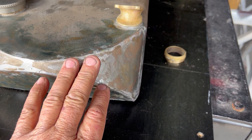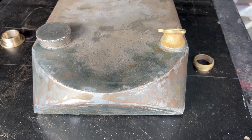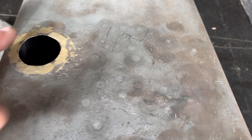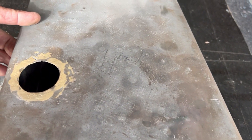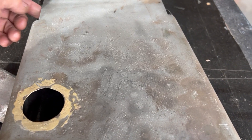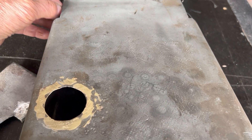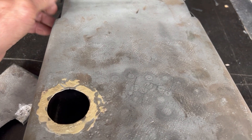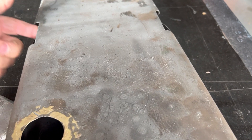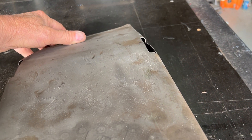I've fully removed one of these pieces; the other I removed back to halfway and beat it out. I've beat this and beat this and put it all back together. I'll put some photos up of the pieces as they were. Now we just need to work our way backwards — fix this first, put the baffle back into place. We're going to spot a piece of wire on these pieces; they've already been tinned. We'll tin the inside again, pull it up, and solder those into place, with wires hanging out on both sides.